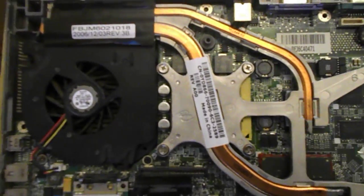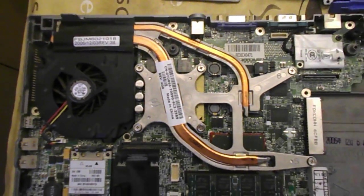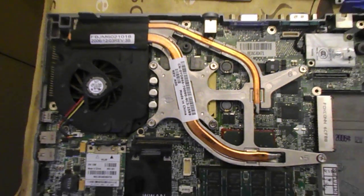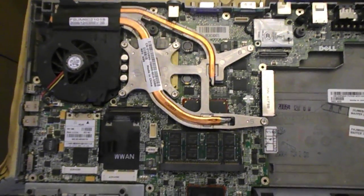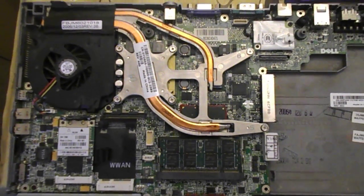Now I'm at the professional level, but I learn every day. So I'm going to teach you guys one trick today. Something happens: if the fan blocks for a long time, then the PC, the board, will tell the BIOS not to try the fan again, not to send energy. So the board would not send energy to the fan at all.